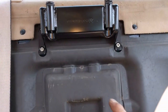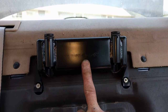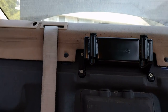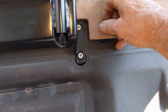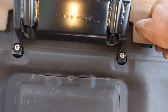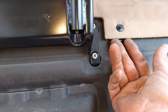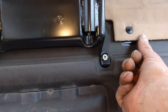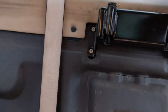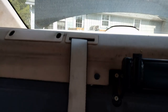Now the back one — first thing you've got to do is remove the headrest support. And then what I do is you've got these pins here; I take something and pull the center one. You can just about do it with your finger. Pull the center one out and then stick your tool under here to pry it loose — that way you don't break the clips as much. You've got a couple clips along there and then this piece will slide straight forward and you'll see where your seatbelts are bolted up top.